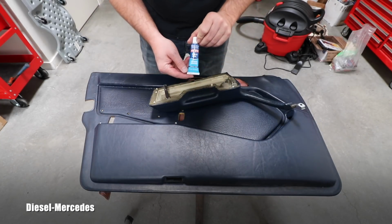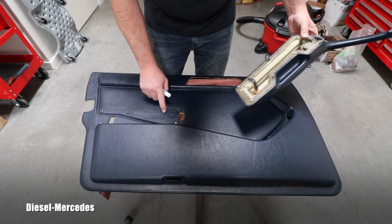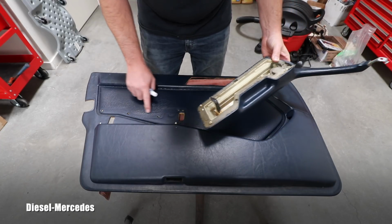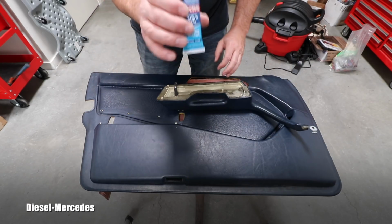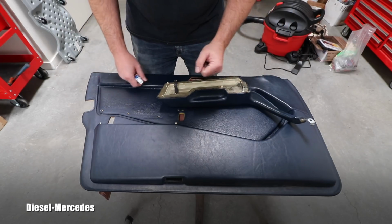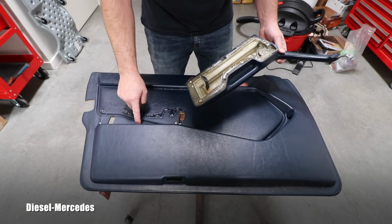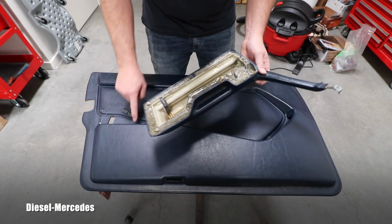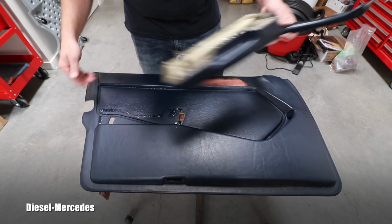My next step is to use the semi-flexible adhesive, and I have areas which are nicely touching each other. There's perfect contact right here. So I will simply glue it, following instructions. I will glue it to the panel. It will make it also stronger. And here I have one of these points. They are in good shape. So I put actually the strong glue in that spot, so I will have another great connection between these 2 parts.